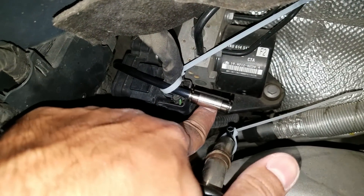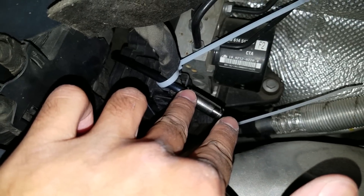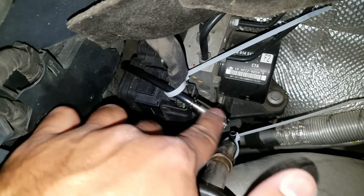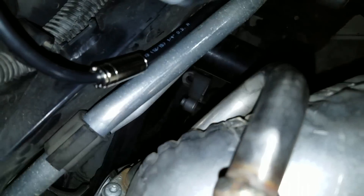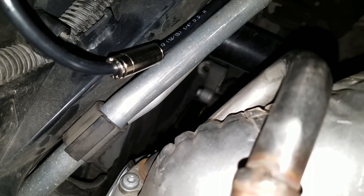I have the adapter on. I cut out the section where the leak was, and now I just have to connect both ends of the hose into here and everything should be good to go. Here's the hose going to the bag, here's the adapter, and here's the hose going to the manifold — they are now connected. The leak is now gone. In theory the bag should work. I think the spot I put it in is better than before — it's a little tighter, more snug, and farther away from the heat source.